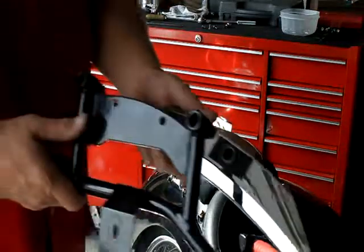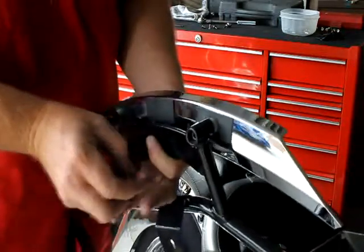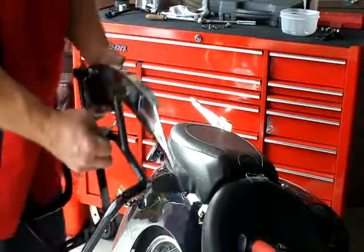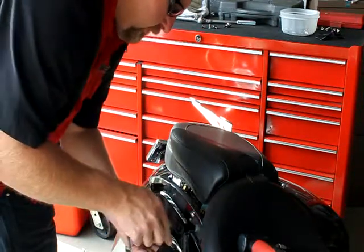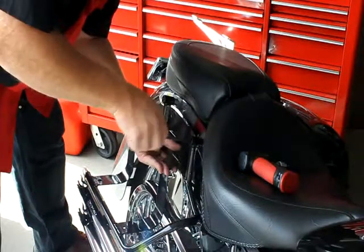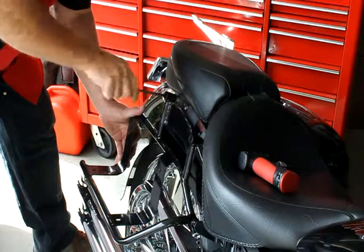Take your victory bag bracket and slide it into the adapter pieces, then put it up and fasten it up to the rear fender. Set it in place — you can see the bolts sticking through, so be careful with your paint. Hold it up into place, get your wrench in, get the first bolt lined up and started a little bit. Do the same with the rear, put the wrench in there, get it in place and started a little bit.